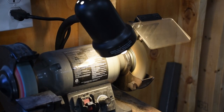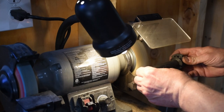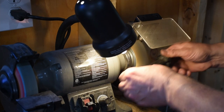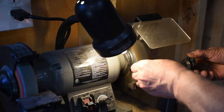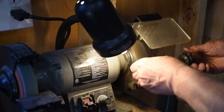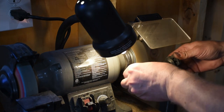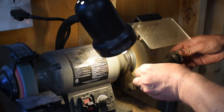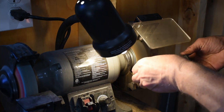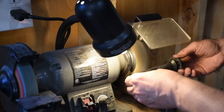After what seemed like an eternity, I was able to peel off as much rubber as I could with a razor knife. I decided to take the remaining rubber off at my bench grinder's wire wheel — it did a really good job of removing the material off of the throttle tube. I still believe this may have been a one-piece unit that you buy right from Suzuki. In the end, I was able to get all the remaining rubber and glue off the throttle tube and salvage it for reuse, but this was not an easy job and was extremely messy. Even with a dust mask and face shield on, rubber bits were going everywhere — be prepared to be a little bit dirty at the end of it.